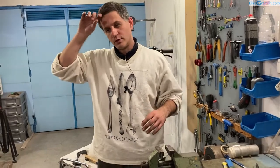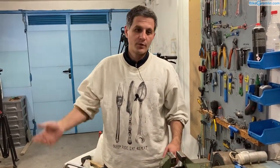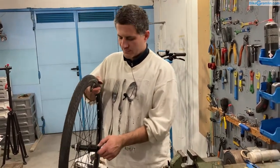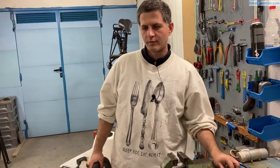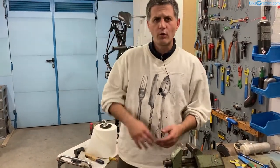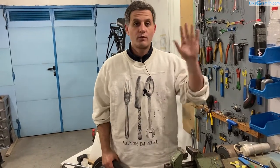It's a very long detailed video, but I tried to explain all the gotchas and caveats you might face when servicing bicycle hubs. I will make a separate video about cartridge bearing hubs. But this is what's most commonly available, and this is a very good system because it allows you to use cheap tools and do it at home yourself. If you service Shimano hubs once a year or every 5,000 kilometers they last for decades — even riding year round in winter. It's a decent solution that works cheaply and reliably. Thank you for watching and cheers!